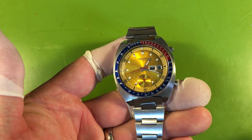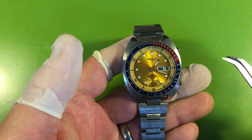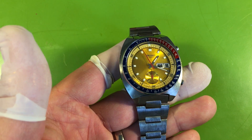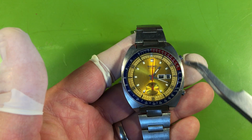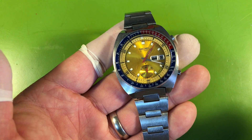It's nice that you have your original watch. We can make it better. It's just building the crown assembly that's going to be expensive. I have all the parts, but they're hard to come by and Seiko doesn't make them anymore — they haven't made them for decades. But with a service, a crown rebuild, and a case rebuild with seals — we need that because the buttons are so sticky — that's really all you need. The rest of the watch is intact.